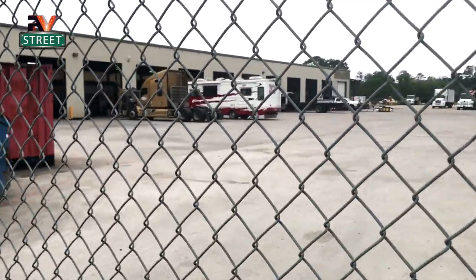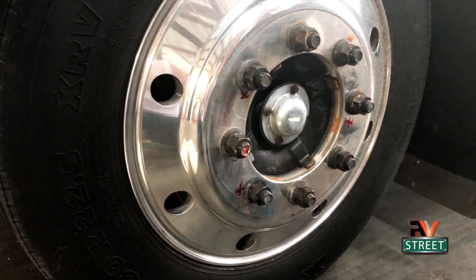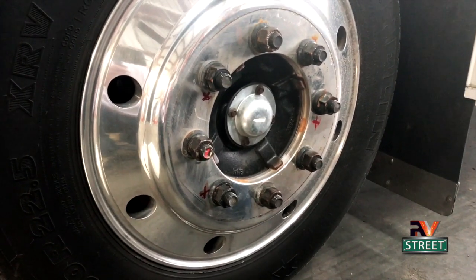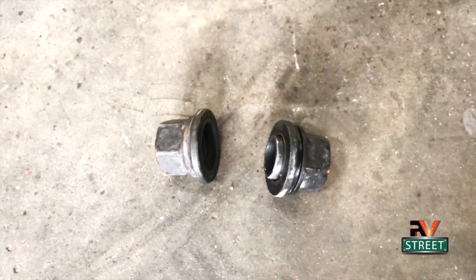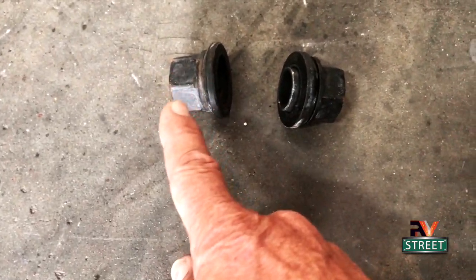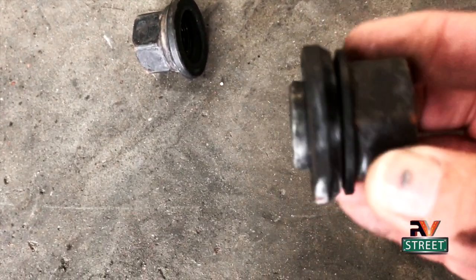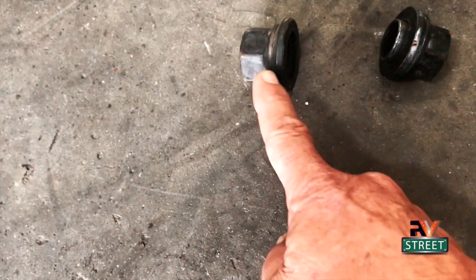These mechanics really know what they're doing. We're here at Jamail's getting ready to pull the front tires and rims. Out of all these lug nuts, we have three tapered lug nuts to center the rim onto the hub - that's a really important thing. I'll show you the difference: these are the OEM lug nuts and these are the tapered ones. I have three tapered and five OEM, and you can see the difference. The tapered ones help center the rim onto the hub before you put in the other five, making sure that rim and tire are perfectly centered.